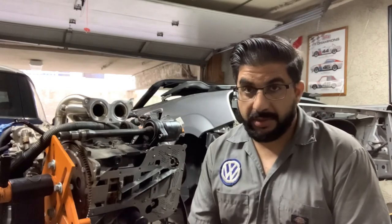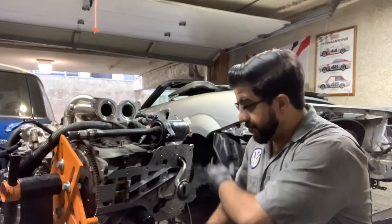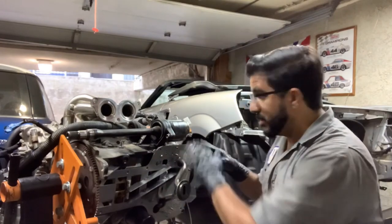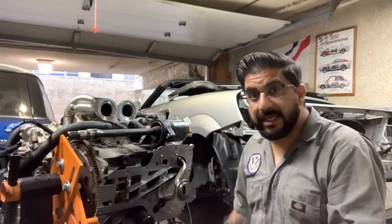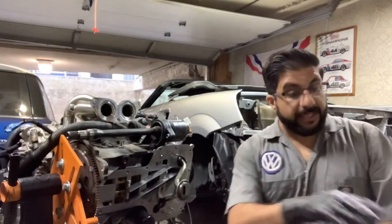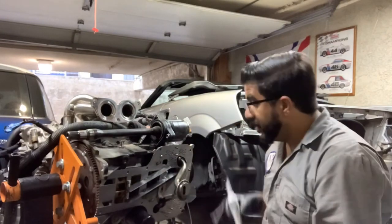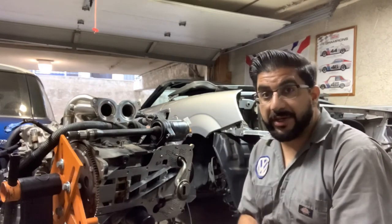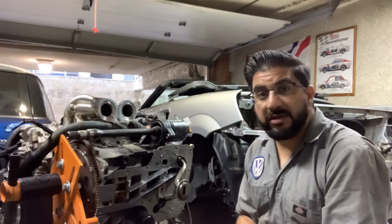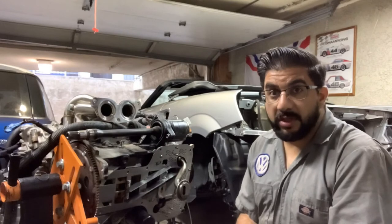The oil pickup was measured and installed — one spacer was enough to compensate and get it to that six-millimeter clearance you're looking for. I've got some gasket maker already on the upper half, about to put it on the lower half and put the oil pan back on. Not torquing everything down yet — tightening it up, letting it sit overnight, then I'll torque it tomorrow.